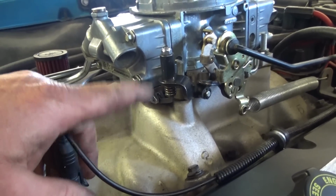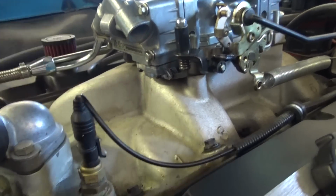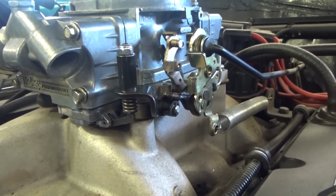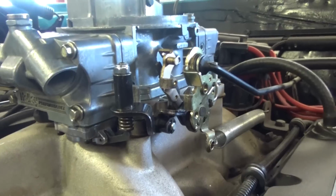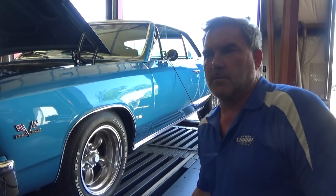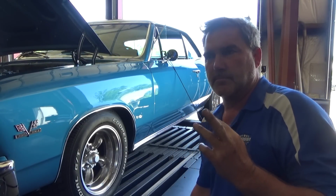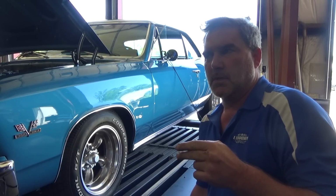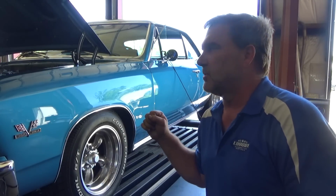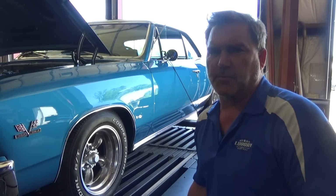So let me grab my feeler gauge, I'll check my clearances there. We should be good, but that big pump and that much larger cam should give us what we need on that tip in. Fingers crossed. Wish me luck. Alright, so 50cc pump, brown cam, position 2. I think we're probably going to need a bigger pump shot, but I'm going to make a pull with just that change, and then we'll up our pump shot from the 40, I think I got a 45 in it. We'll go back up to the 50 and see what that does.